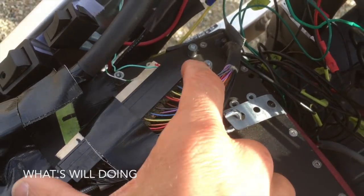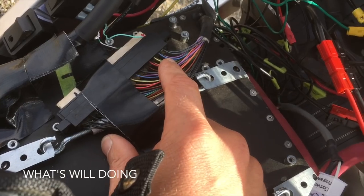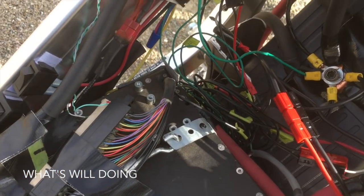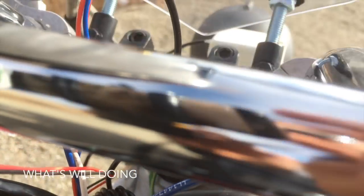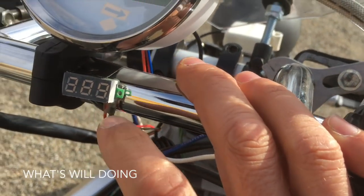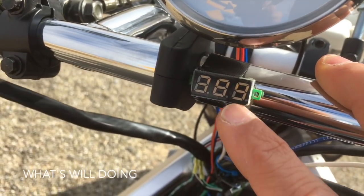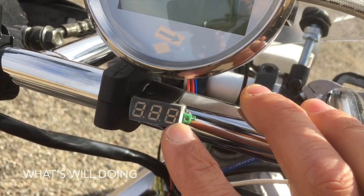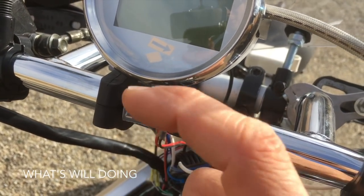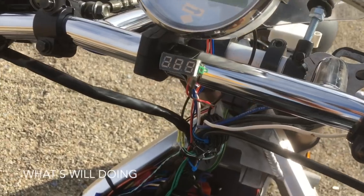This is the tab right here — this would normally plug into the circuit board on the Zero motorcycle and interface with their OEM bike board, but I don't have that. So I just take my voltmeter and check between all these wires to check all the different cells. What I can do while I'm riding — and also while charging — is use this little voltmeter I got from Banggood. I'm only monitoring lipo cells so I only need to go up to about 4.2 or 4.3 volts anyway. It works great at night; I got the orange color so it's not too bright. During the day it's a little bit hard to see, and right now it's only monitoring one cell. I actually bought a whole bunch of these and was going to have an array where I could see all my individual cells in real time, but that's going to be a nightmare to wire. There are some websites where you can actually find BMSs that have a nice little screen.